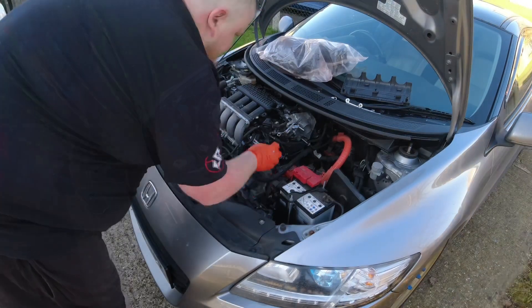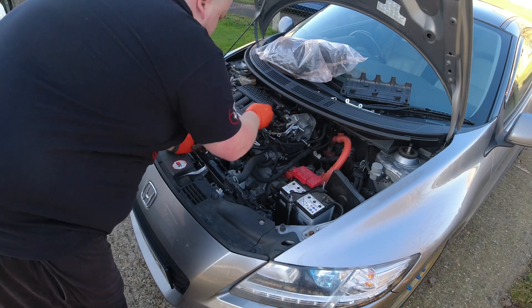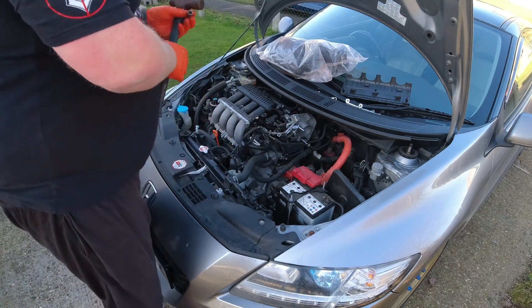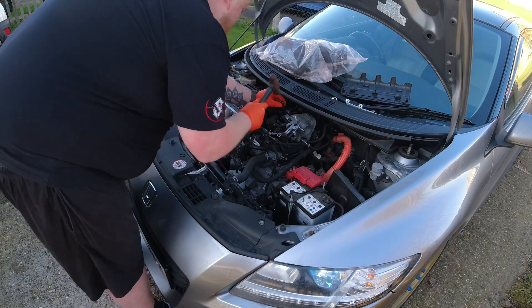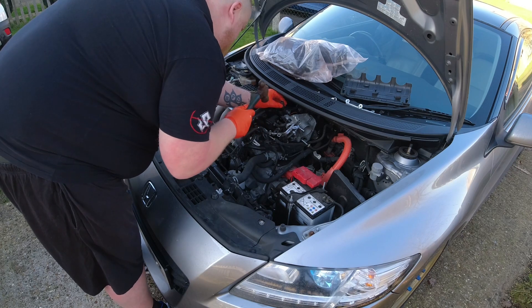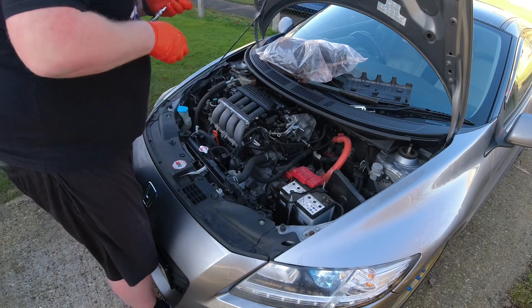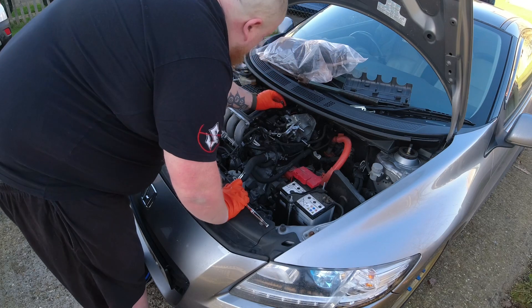With the throttle body now removed from the intake manifold, I'm going to tackle this little map sensor. What you need is one of these bolt biters, really. These are by Irwin. This particular one is a 5/16ths — yes, obviously American. Pop that on there, give her a couple of love taps. Hopefully she will come undone. Doesn't feel like it's going here. Might have got the wrong size, actually. Seems like it's all right though.